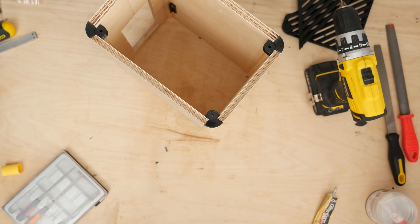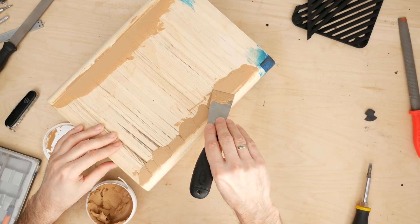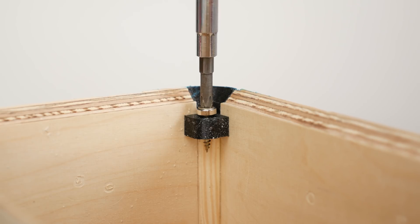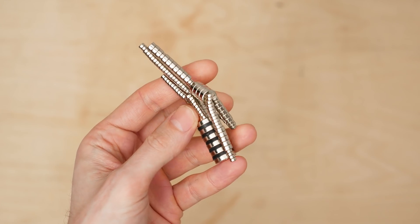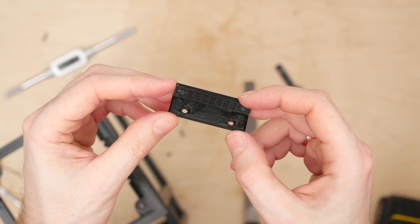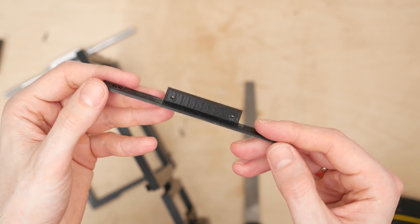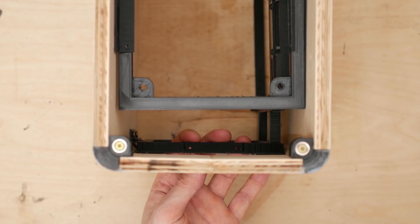I used filler with bits of fiber around the three printed corners and regular wood filler for the rest of the case. While waiting for the filler to dry I screwed in the small magnets — I ordered a handful in different sizes since I didn't know what would work. After the filler dried I sanded down the surface. The last thing to do inside was fixing frame anchoring points: one on the side connecting to the fan frame, and another on the bottom surface that would screw into the GPU support.